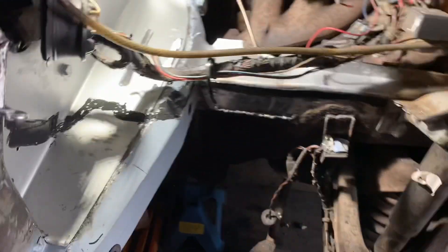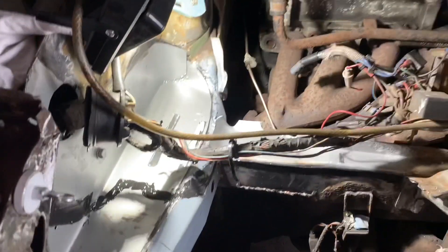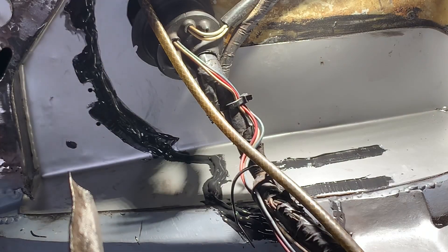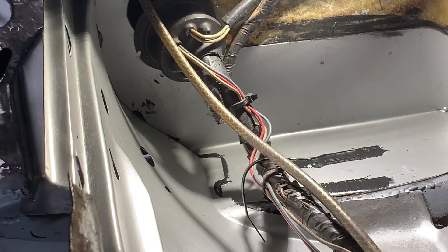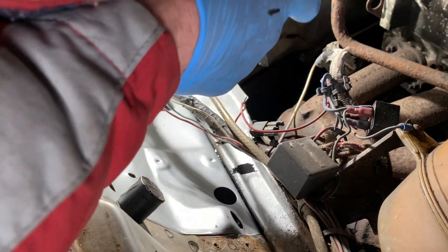We've got our primer coat on now. We're going to put a thick bead on the actual car and attach the panel. Remember, you can slide the panels together but what you can't do is push them together and then separate them. Once we've got it in place, we're going to use all of our neodymium magnets to stick it down. I've got to try and get this in without separating the panels or getting glue all over the rest of the car. I'm just going to put these battery brackets in now — I'm gluing these in and not welding them in because they're very prone to rust, so I'm not going to run that risk.